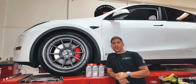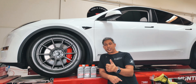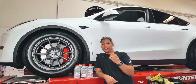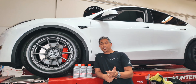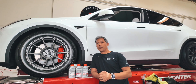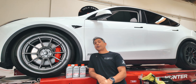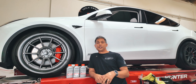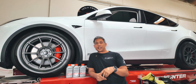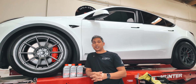There are three things that we typically use in that menu, and this does exist on the older platforms. The first one is the brake stiffness test, which shows you exactly how much pressure you're getting out of your pedal. The second one is your brake bleeding procedure — it will actually do the pumping for you and open the ABS pump up so you can make sure you're flushing all the fluid through. The third one is the brake pad burnishing procedure. We're not going to be doing that today, but it exists in the menu and it's relatively self-explanatory.